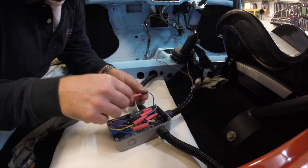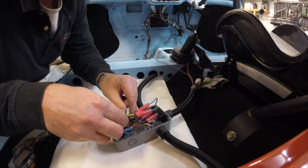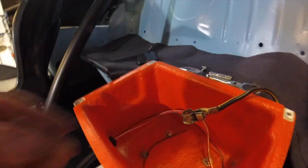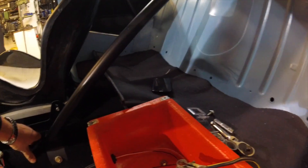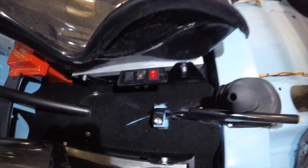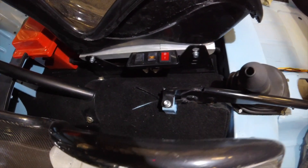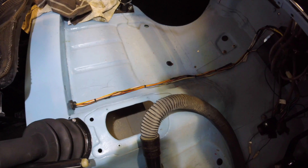They're all shrunk down — these do offer better resistance to the bullets, nothing should ever happen in here. It's all essentially a sealed box. I'll just tidy this up with a few tie wraps. It's just inside the battery box — that's where the heater cable comes in. That will have an inline fuse connected, because there's no protection on that line at the moment. The battery is set here, that's the earth lead, and there's the earth off the relay to be connected as well. That's the panel in situ, seats fitted. There are no wires that are really visible — all this bit here will be taped in place and the carpet fitted on top, so that will all be hidden from sight.